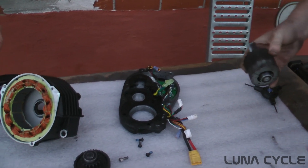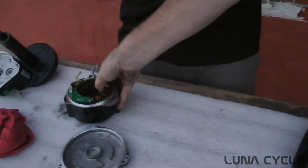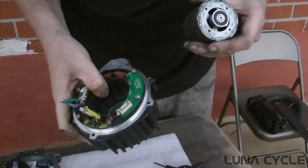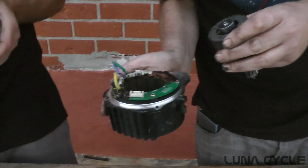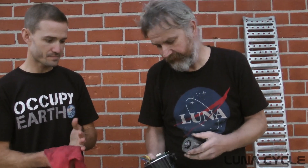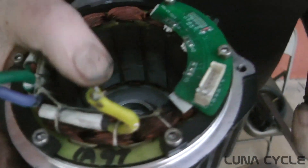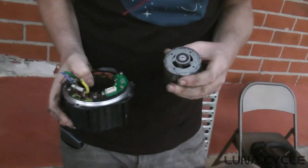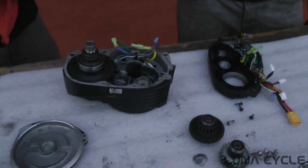Here's a blown BBSHD since we've got them all taken apart. This was a customer's unit where we switched out the core — you can see it's been beat up and you can see how they fail. It doesn't happen often. Maybe two blown motors and two nylon gears. A lot of it is water damage — water gets inside somehow. Actually, looking at this, it's from when we ran the Adapt controller that wasn't properly tuned for this motor at all — it was out of phase and was getting really hot.